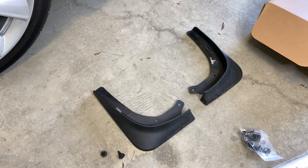This video is a comparison of the RPM Tesla Model 3 screwless second generation mud flaps and the OEM Tesla mud flaps. Looking at my setup — I'm lowered on Mountain Pass comfort coilovers about an inch all around. The reason I'm moving away from the RPM Tesla is because when I go over speed bumps it would bottom out; it wouldn't flex. The OEM mud flaps are made of a softer material that does flex. We're going to see how the clearance is over the ground and compare the height and length of the mud flaps to see which works better for a lowered vehicle.